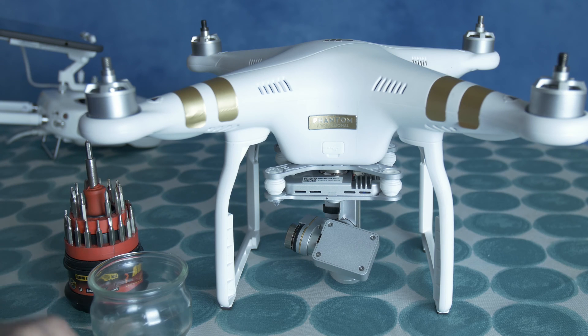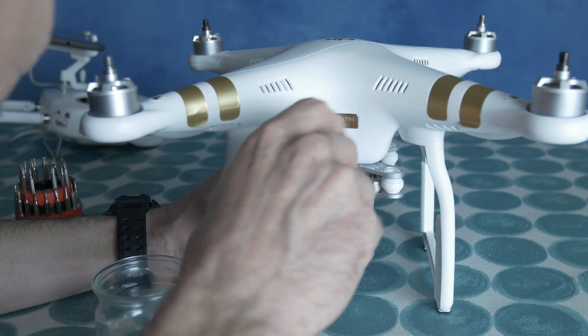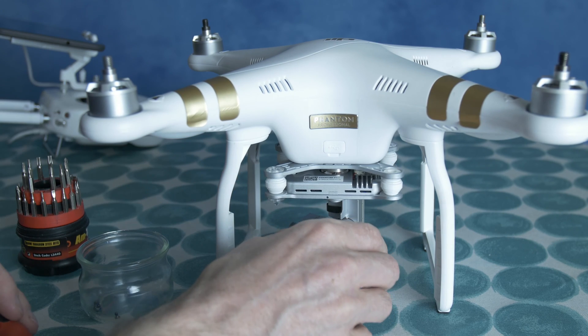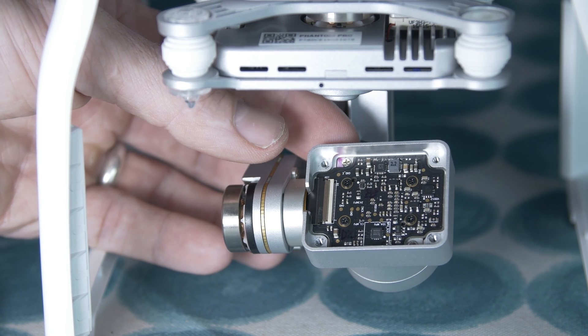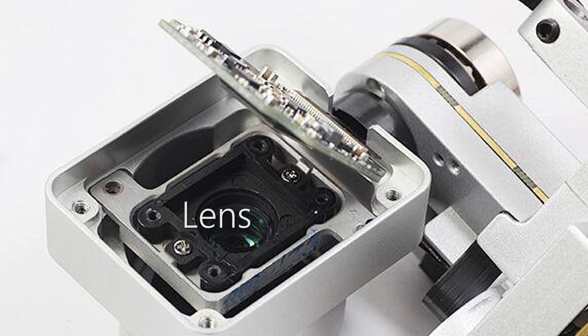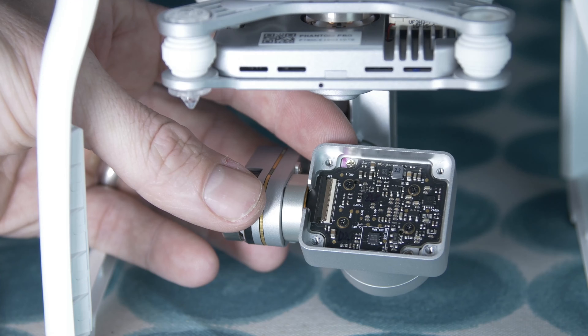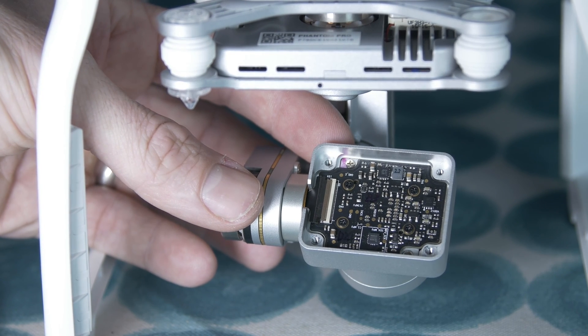If you look at the camera housing on the Phantom series, they are made of metal — I believe it's aluminium. I actually took the screws out of the back plate and removed it to have a closer look at the construction. What you'll see here is the internal workings of the camera — the back sensor board, and on the other side of that board is the sensor, which is aligned with the lens elements through the lens barrel. What I believe is happening is that in cold weather the metal parts, which are screwed in with four black screws, are contracting and moving around. This moves the focal plane that the sensor is aligned with, causing certain parts of the image to move out of focus.